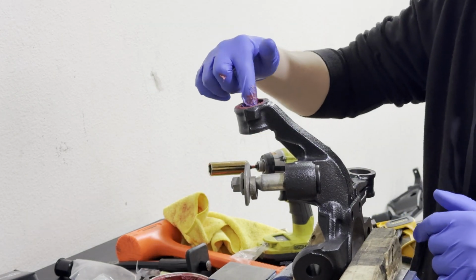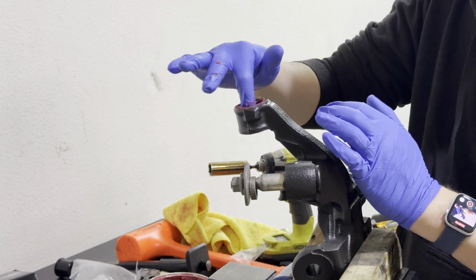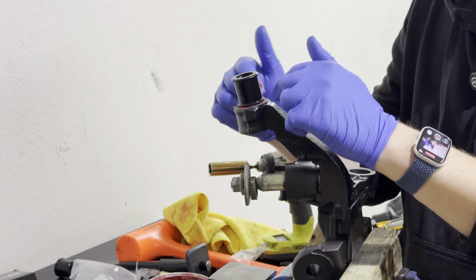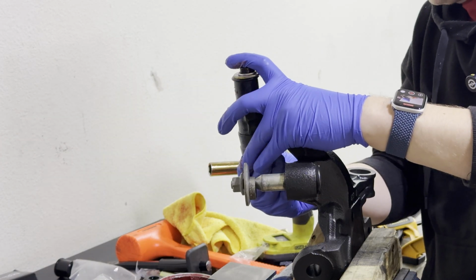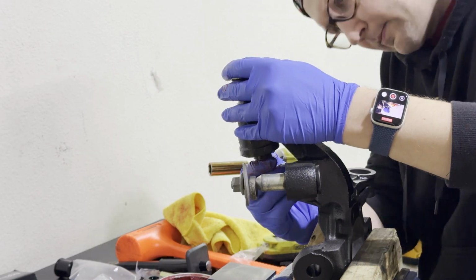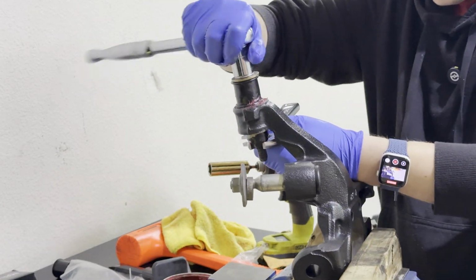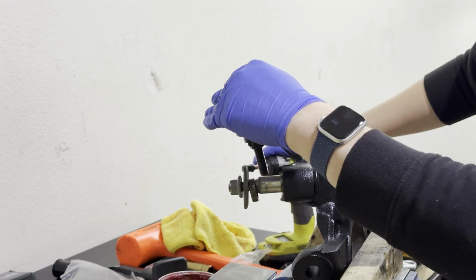Plenty of grease. Also, you do want to make sure that you press the bushing into the chamfered way. If you look really closely on the lip of the knuckle, there's a little bit of a groove and it allows the bushing to seat itself a little bit. Then whenever you're pressing it in, it creates less resistance and it doesn't cut into the polyurethane bushing. The key here is just to take your time and not get frustrated, because it does get annoying to mount all the hardware around. And sometimes that happens. There we go. So we got it going.